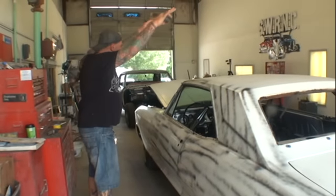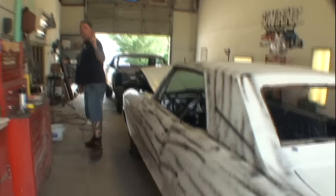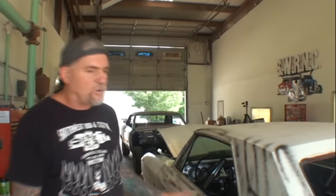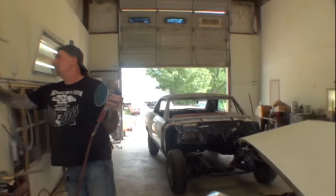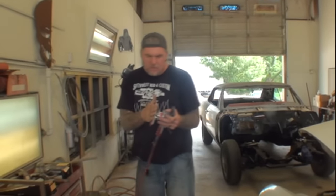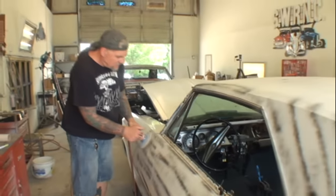So let's say we just did the whole car with the guide coat. Now we've got two ways to find our dents — and the way we're going to find them is by sanding. We can hand sand block it or use a DA sander with 180 grit. You don't want to use 80 grit because it's going to take the paint off and then you'll really be lost. So I'm going to put 180 on the DA and go over this to remove our guide coat. Wherever there's paint left on the car, there's going to be a dent. I'm going to use 220, and sometimes it's even better to use 320.